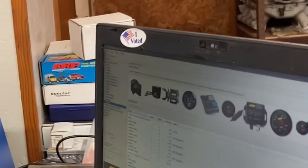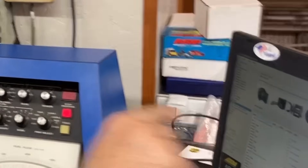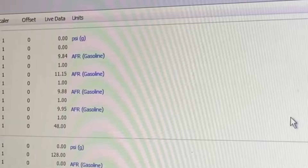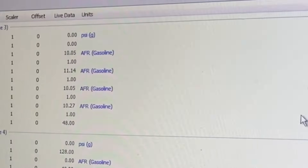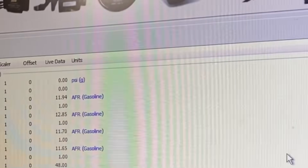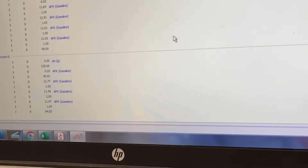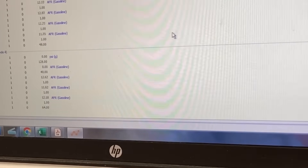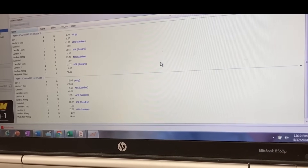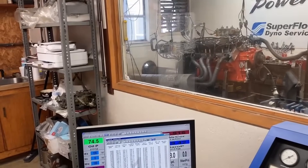I don't like that at all. What do we do? If you fix that corner, the other ones are the issue too — see, that cylinder is a problem. It's all ratty right there. Nine to one on that one, a little better on those two. So that's cylinder one and cylinder three. They're in two different corners. So if you lean those out, you're going to lean the other two out. You can't just pull some jet because you're going to kill the ones that are already too lean.